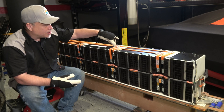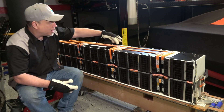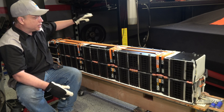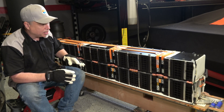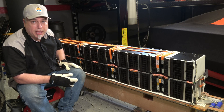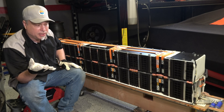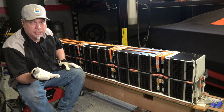I'm going to take apart the intermediate bus bars first, then the ones that go to the contactors, and lay those aside to get them out of the way. That way everything will be isolated. The batteries will still be connected to each other internally, and we'll take each one off independently. Get yourself some lineman gloves — typically leather, a little expensive, but if you slip and do something stupid, it's cheap insurance.